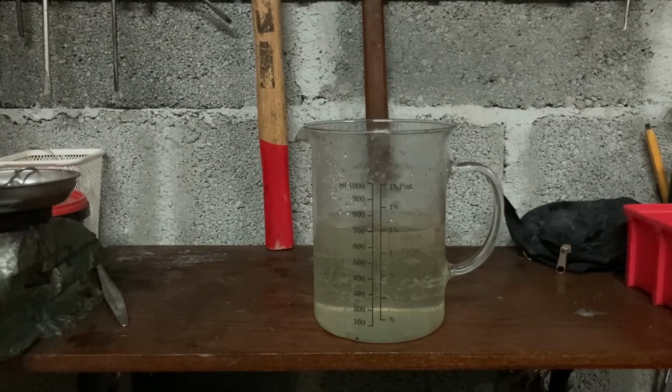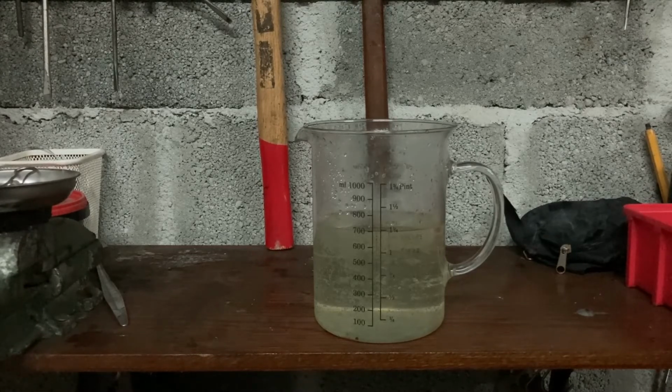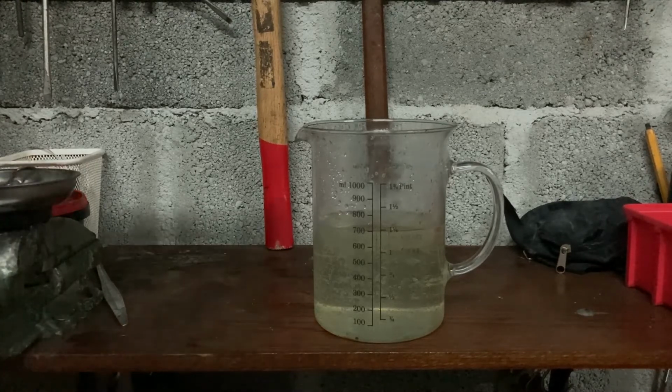And here we are 1 day later, after 11 drains and topping ups with only distilled water, and this is how it looks like right now. As you can see, it's not perfectly water-like. In fact, it will be impossible for it to be perfectly water-like no matter how many times you drain it. But we've reached a point where the liquid is very, very clear. You'll see at the end the comparison between how it was at the start versus how it looks now. And we're just gonna double check the fact that this is effectively just water by measuring its density with our little tool.